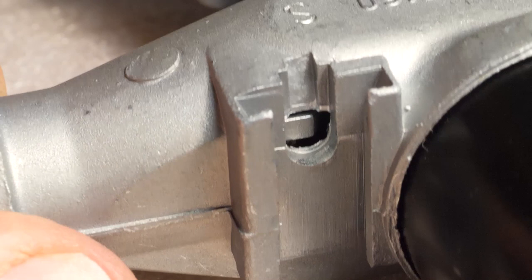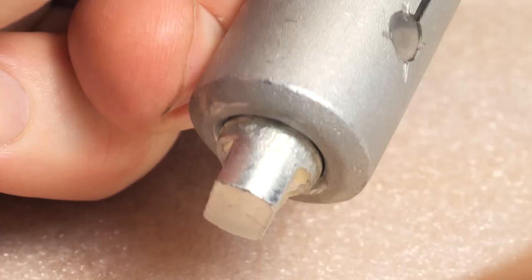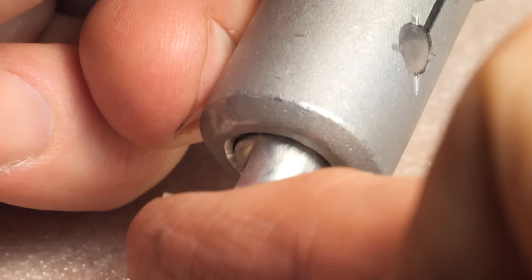So when you turn the key, this slider pushes up. And then when you pull out the key, it snaps back, and that's also part of the steering lock. This pin slides back and engages with the steering lock, but this slider is what pushes a little pin.